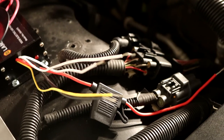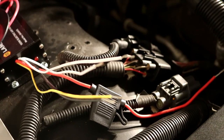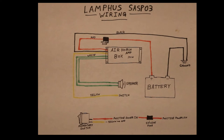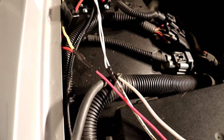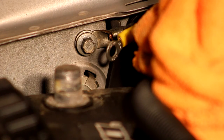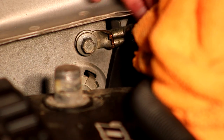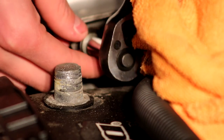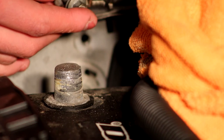Now we're going to need to wire all of these wires, and I made a super simple wire diagram for you guys to follow. This wiring diagram shows exactly how I wired this unit with the momentary switch to this vehicle. I'm going to be doing all my soldering off camera so I don't bore you with tons of soldering. Now that the soldering's done and looking nice, let me show you how I'm running these wires. I have both of my switch wires running through an already existing hole in my firewall. I'll use this crimp connector to connect my ground, and after crimping that onto my cable, I'm going to ground it with this other cable on this bolt. I had to take my battery's negative terminal off to get my ratchet to fit.